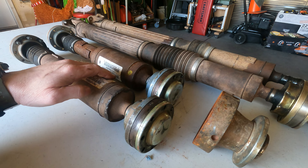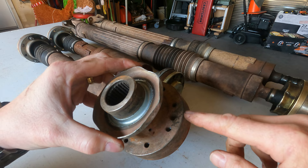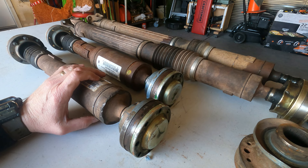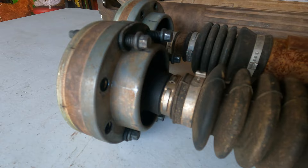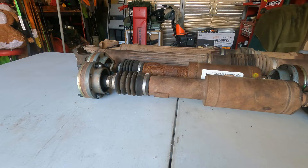When the two of these are together, you use these holes here and a punch and a hammer to remove the drive shaft from back to front — not by beating on the end of the tube. It was vibrating like crazy after somebody removed it that way. My hypothesis is that when this was beaten with a hammer, it changed the balance of this drive shaft. At the time there was absolutely nothing wrong with this drive shaft — joints were good, boots were good — but it started vibrating. Do not use a hammer to remove your drive shaft.